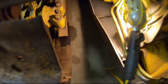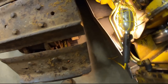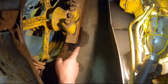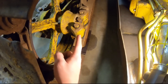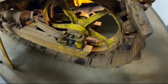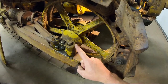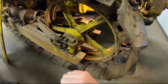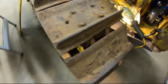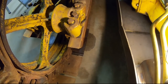So the first and most common one is: what's leaking? Well, everything I say, I say for a reason. We should already know what that little oil puddle is coming from if we followed along with the front idler rebuild. In a nutshell, this is the early design front idler that does not have oil seals, and we use semi-fluid grease because of its flowable properties. So when you have grease that flows easily and put it in a container that is not sealed, a certain amount of it will run out. Long and short of it — nothing's leaking. All that is to be expected.